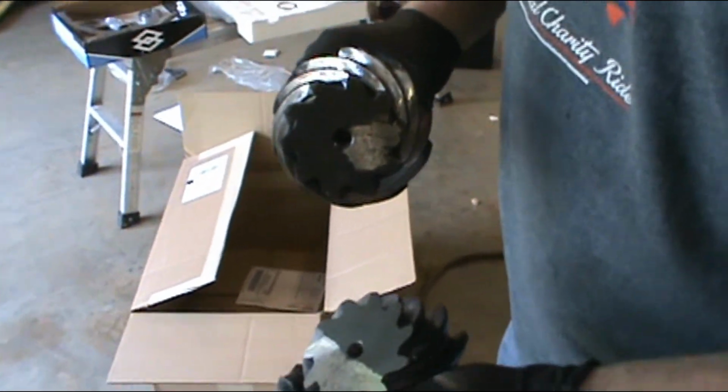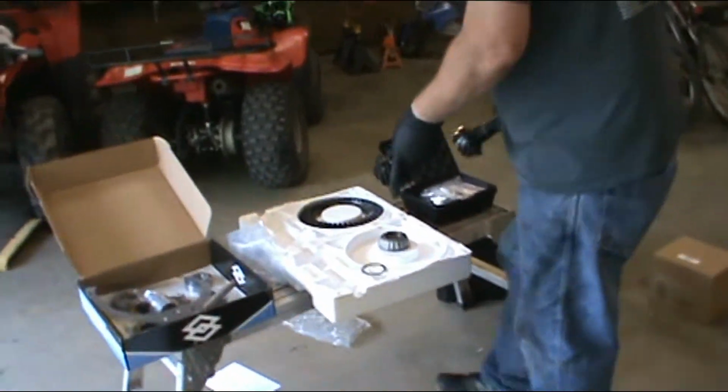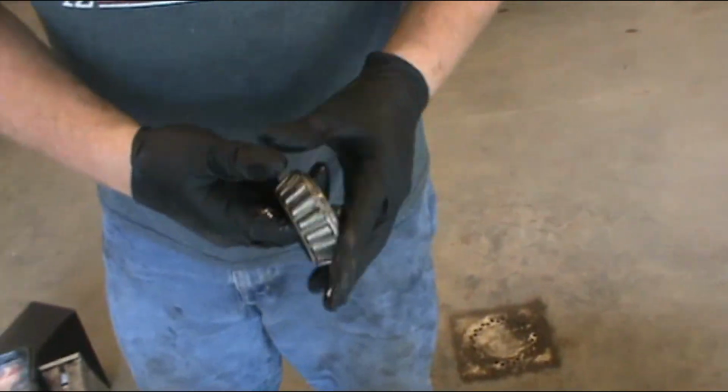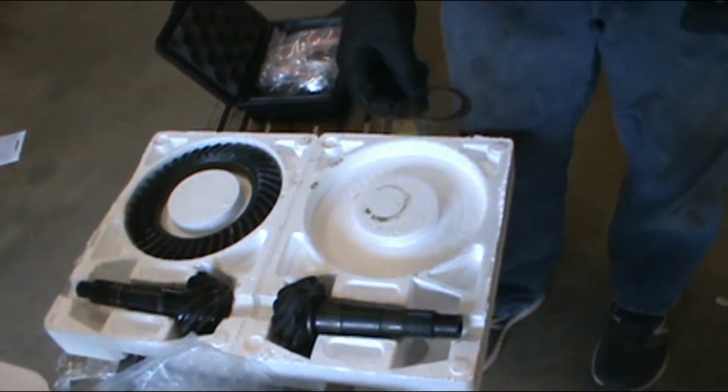And we're going to go over how to measure that, but first things first, you can go ahead and keep recording. We're going to take our old bearing, and we're going to make a setup bearing, because you're still going to have to start off, at least on a GM 12 bolt, with a guess as to how deep it should be.